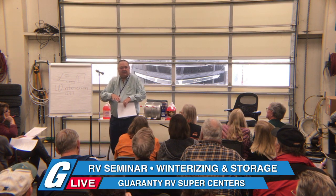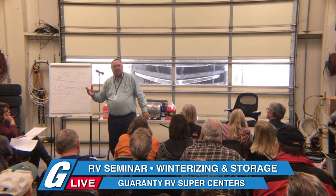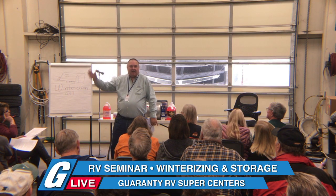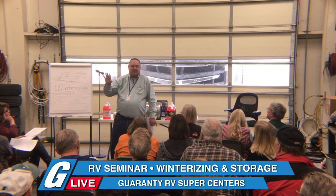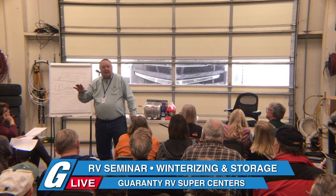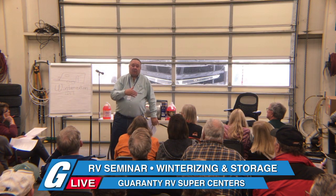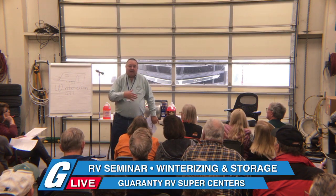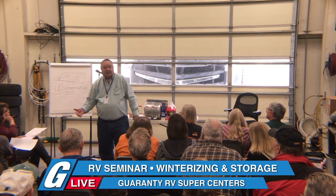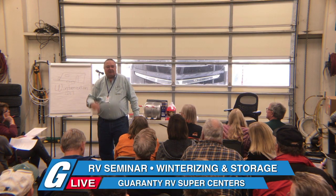And it vaporizes, and the bleach gets in the pores of the plastic. I mean, it's a very toxic environment. It's a strong bleach environment. And it kills everything in there. And it kills everything in your lines and your water heater. And then you rinse that out, and then you do the same thing. If you don't like the bleach, you do the same thing with vinegar. I like to do that because it makes it really smell fresh and the bleach smell is gone.